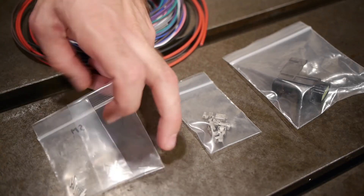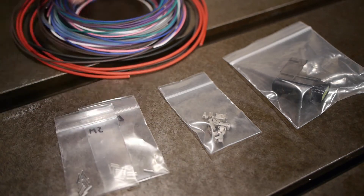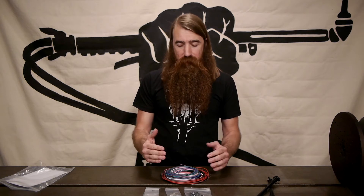We also have two different sizes of ferrules. These ferrules are used to make terminations for any type of a screw terminal block, like you have on the M unit. By using these you prevent the possibility of a fatigue failure of the wire as it exits the screw terminal. That's the rough overview of what these components are — I'd like to show you a couple of techniques for how to assemble these correctly.